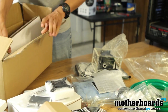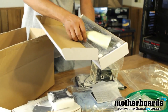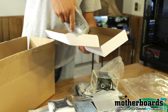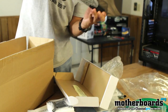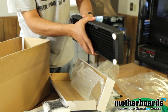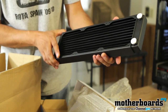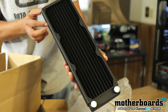And this large box here is your radiator. For those of you that are familiar with water cooling, you'll have to understand that before using something like this it needs to be flushed — you want to get all the particles out of it before you actually install it in your system. So flushing this unit will probably be my next step.